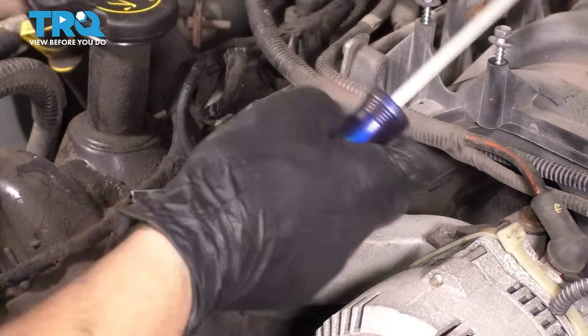All right, this valve cover should be free. Yep. Pull it up. Get the gasket up with it. There's one of them. All right, on this side it's going to get a little more interesting because the wiring harness is a lot stiffer. It won't move out of the way like this one, and we'll have to get the bottom bolts from underneath from the wheel well, because all of this is going to be in the way. So let's just do the top first for now.